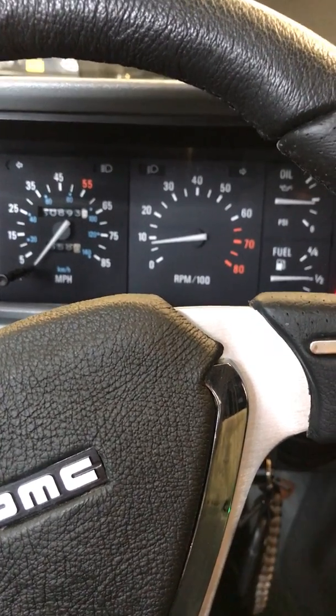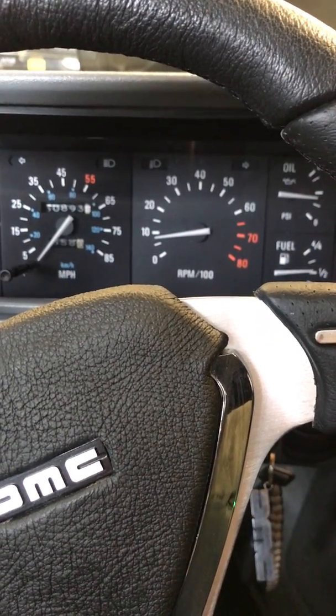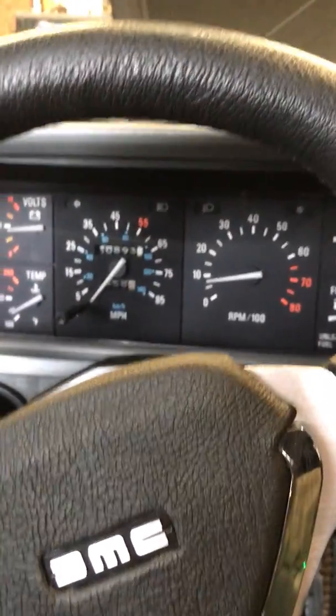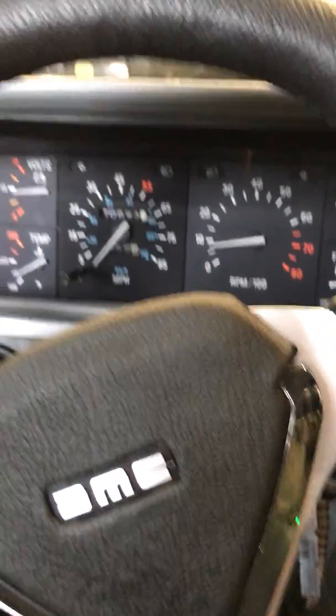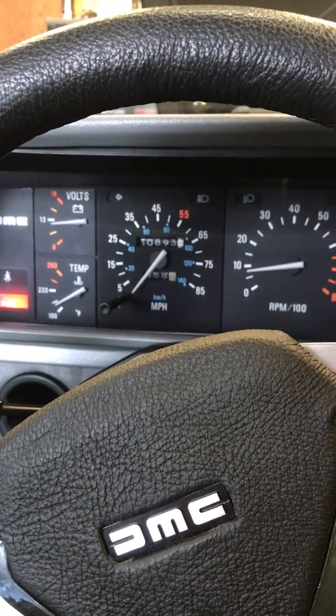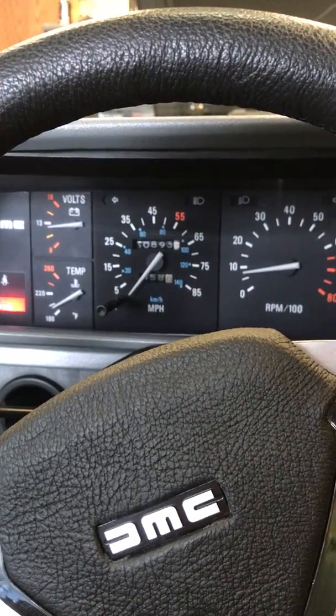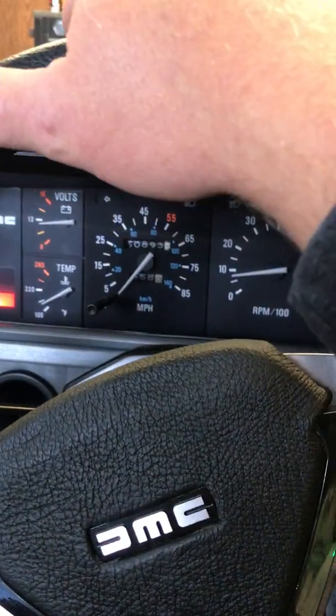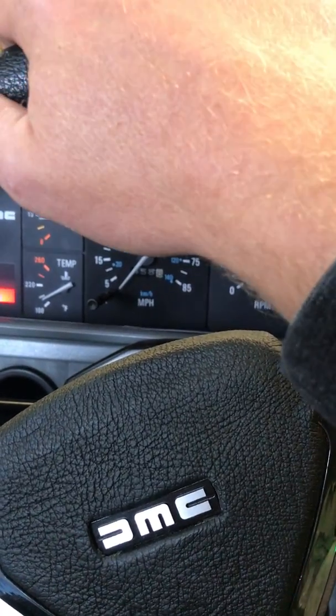Alright, so pretty quickly there, it goes right back down to my 775. It didn't do any of the idle hunt right away. You can tell, but there's a little bit of a vibration that I can even feel in the driver's seat. You guys can probably tell by the jumpiness of the camera, and that's primarily what I'm talking about. I'm just trying to get rid of that for good. So let's go ahead and go back to the back, and I'll show you what's going on there.